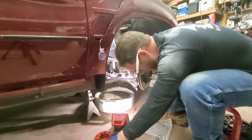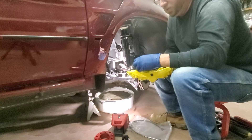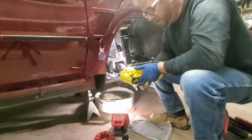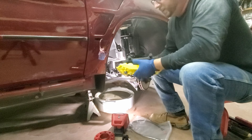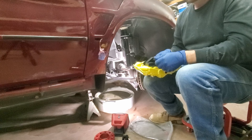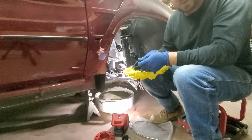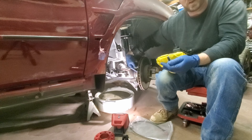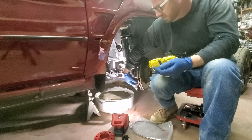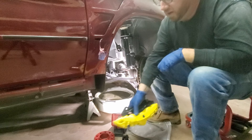You do not have to reuse the old mounting bolts — these bolts right here — because the heads on these typically strip off. At least on mine they did. It does come with new ones, and I recommend using the new ones if you ever get this kit. I'll try to link where I got these in the comment section. These are all aluminum. It does come with a mounting bracket right here — you just take these two bolts off and it slides right off. You've got these bolts to put onto the bracket itself. On the other side, I noticed I had to do a little bit of clearancing. I clearanced on the ears on the mounting surface on the spindle, just a little bit — especially the bottom one, because where they had the molding cast it had a little burr on top. So I had to shave that down, and once I shaved it down this thing fit in really nice and well. Once I got that taken care of, it was a breeze putting it on.